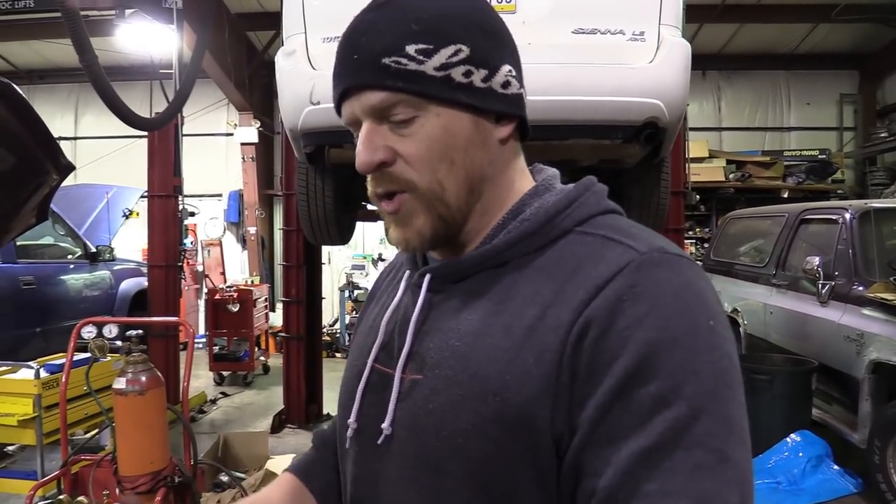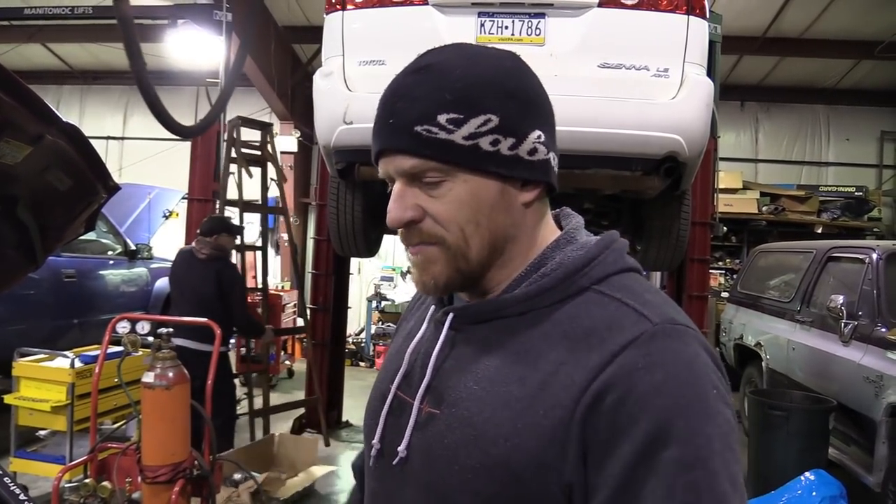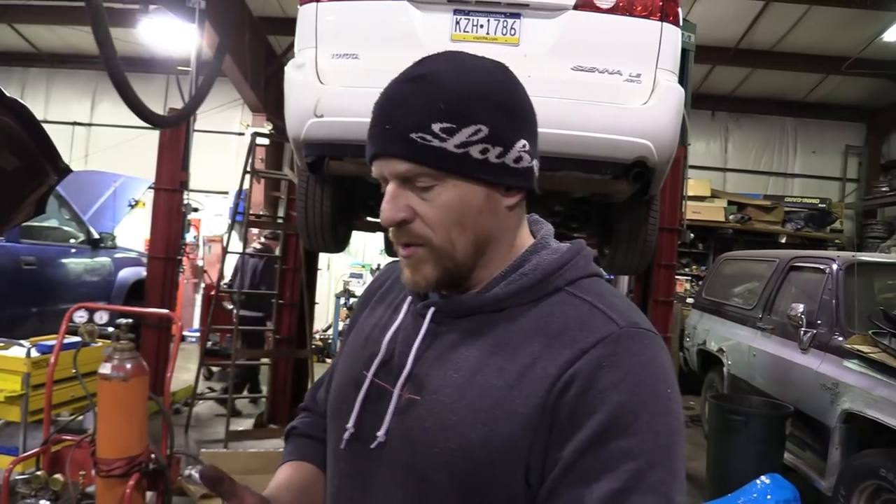We just got to tighten up that power steering belt and we're done — I'll put this stuff back together. Guys, I hope you learned something from this. Our reasoning as far as what actually failed first — the weak coil assumption was off, but we were on the right track with the progression of things. I do believe that when the students put that thermostat in and disturbed that distributor cap, that's where all these symptoms came from. I'm sure my son had some misfiring on occasion before due to that problem. We'll look up code 12 to make sure that's still the EGR temp sensor fault, but as far as the misfire goes — we are done.